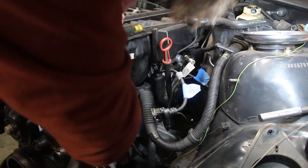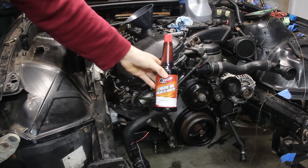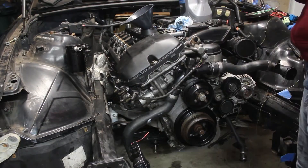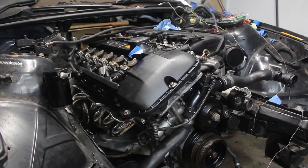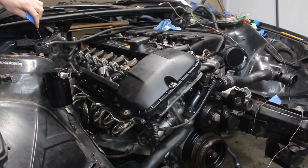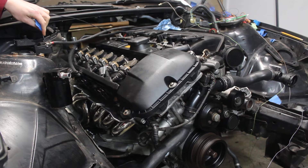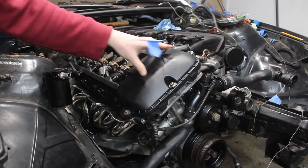Then I went back to the starter motor. I didn't want to crank the motor without oil, so I filled it up, adding some break-in additive. Then after connecting the power cable to the starter, I did a quick check to verify. This is my starter control wire, so it should crank. Battery's low, but yes, that does crank — that's good.